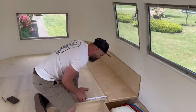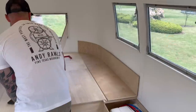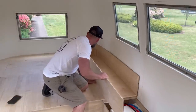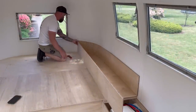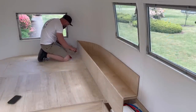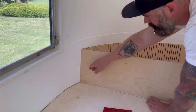I had just enough room on the front edge to add another half-inch sheet of ply to box the whole thing in, and so far we were looking pretty good. So with that piece still in place, I ripped down another piece of half-inch ply to 11 inches high and brought it into the Airstream. I needed to scribe that front edge to match the curve of the Airstream for a nice tight fit against the front wall. I held the piece in place, pushed it tight at the top, measured the gap at the bottom — all I had to do was cut a straight line at an angle. Back into the shop to cut that angle, then back out to the Airstream — perfect fit.